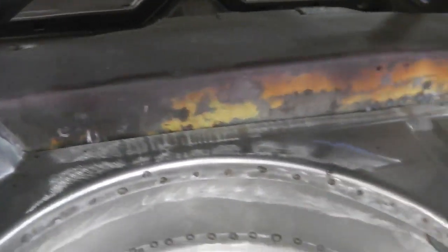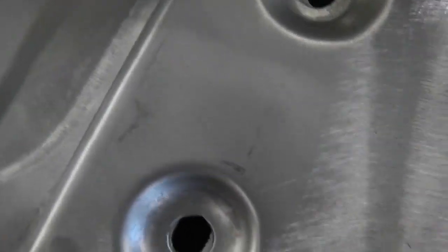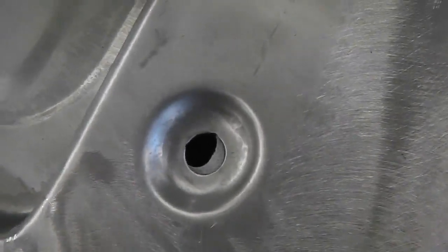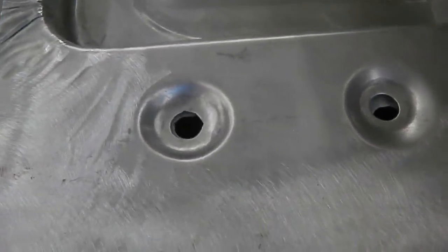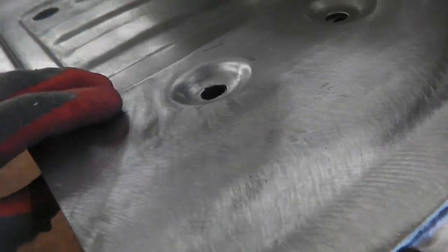We're right up against that bulkhead, that rear over axle bulkhead area, and then we land virtually bang on this leg, and that's using those diagonal measurements to position the leg in. You can see that I don't think we're going to be complaining about that. A little bit of force needed just to get it exactly in the middle, but I'd rather things go in under tension anyway. And you can see there, that's where we are, and we should be flush fitting with the leg onto the face of the boot, which more or less is. Yeah, that's not even pushed down, there you go.